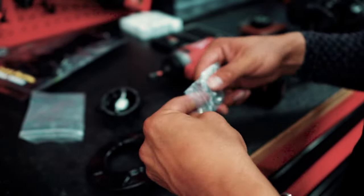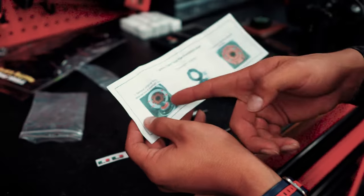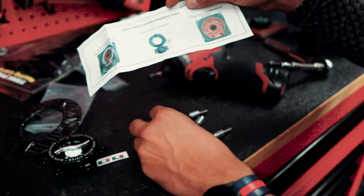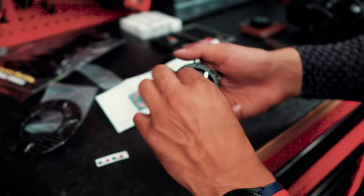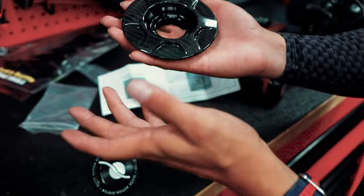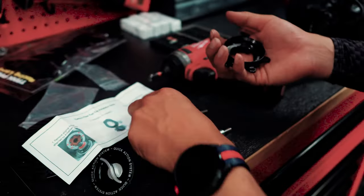Let me check the instructions. So this is the original cap — you pop it out, take out these four bolts, the little spacers go on there. Once you put the spacers, you bolt on the patented bracket on top, and then you push the cap into the bracket. It's almost like a cover. I actually like this a little bit better.